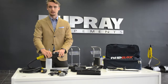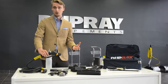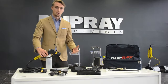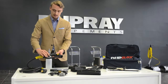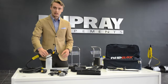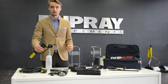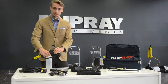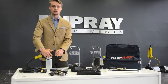If you have the Hill Injection or the Carmen Super Inox, this button here will be either an injection of hot water or injection of detergent. So when you push that button you'll have your boiling water injected or the detergent from the Carmen or Steam Box. On the inside you'll have your steam trigger — this is the trigger that will release the steam. Without holding this trigger, no steam will ever come out of the machine. You have to hold it while using it, and this is for safety so if you drop it on the ground, steam doesn't keep coming out.